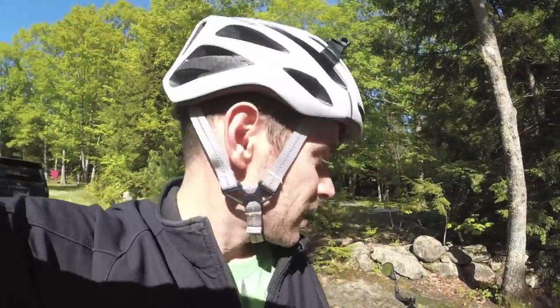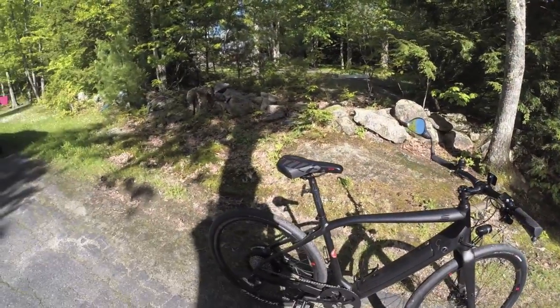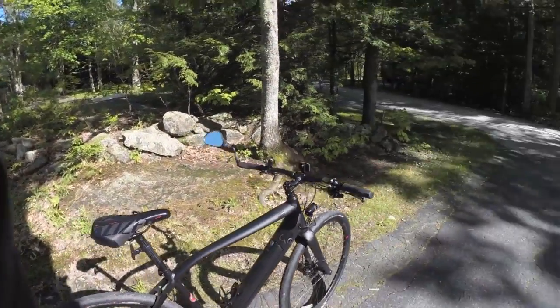You've got the motor assisting you, and in this case for quite a while, given the 14 amp hours of capacity. But also if you run out, you're dealing with a 50+ pound heavier thing that's even resisting you a little bit. Unless there's a huge hill, you can regen, but it doesn't generate electricity that quickly. So I guess keep that in mind.